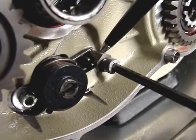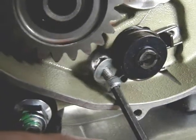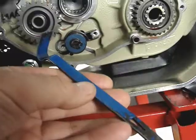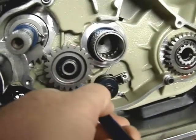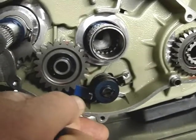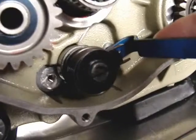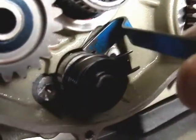You will remove those two bolts. Pay attention to the eccentric cam and the position that it's in. When you remove the one that is down in a depression, you will be able to get in behind that with some kind of a little prying device and begin to extract the shift mechanism. Or you can tap on it lightly from the other side where the shift pedal was. Then work side to side and you will see this bearing begin to appear that's on the shaft — that bearing right there.